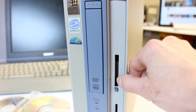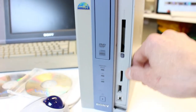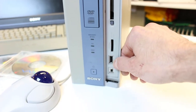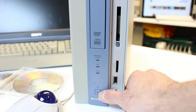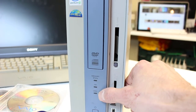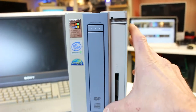There's a PCMCIA card slot on the front which is unusual for a tower computer, and then Sony's proprietary memory stick slot. Another USB, a 4-pin i-link Firewire port, power button, status lights, memory stick access, hard drive and disc indicators. And there's a DVD-ROM drive there - it says rewritable on the front.